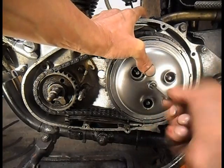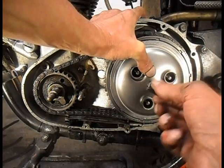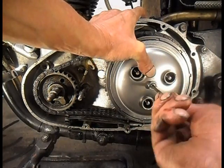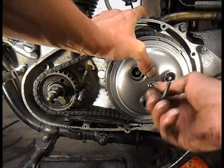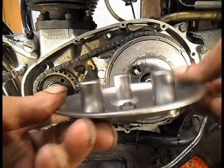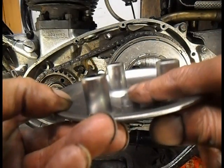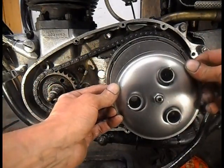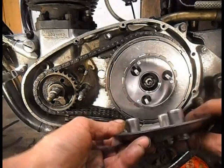Just took it on the push rod there, it's just starting to move. So yep, plenty of adjustment. I'll just see where that is. It's just touching there. And I don't know if we can see, it's just sticking up, so that's where my adjustment's going to start. As the clutches wear down, that goes in, so that has to be unscrewed out to keep it correct.